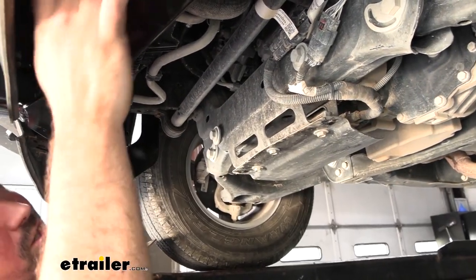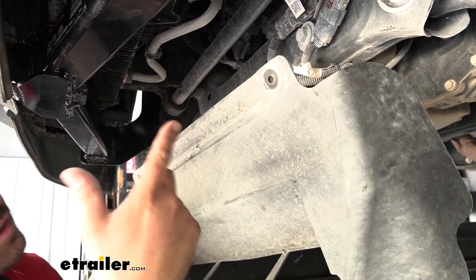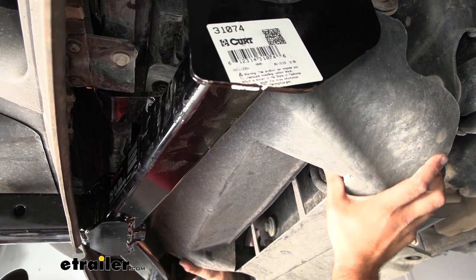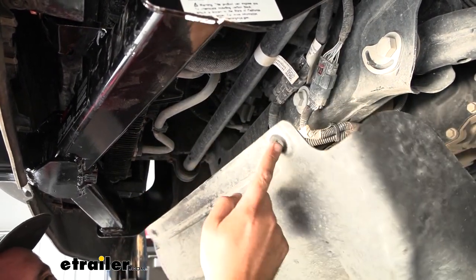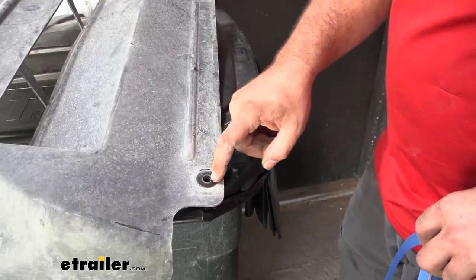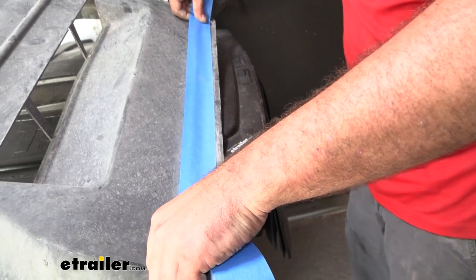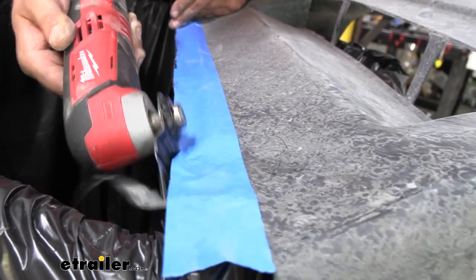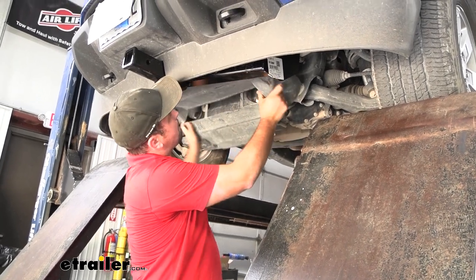As for the skid plate, it pretty much blocks exactly where the original bolts were mounted. According to the instruction manual, you just trim off a little bit of the edge to account for the hardware that's now in the way. The plate slides into the mounting tabs, so trimming that edge should allow it to go back in. It almost lines up with the holes already — just shave off a little bit. Keep in mind you won't have hardware in the front holes, but it's sandwiched in place so it won't come out. Use painter's tape or a line as a visual reference, trim the edge, then get the skid plate back in and put the factory bolts back in.